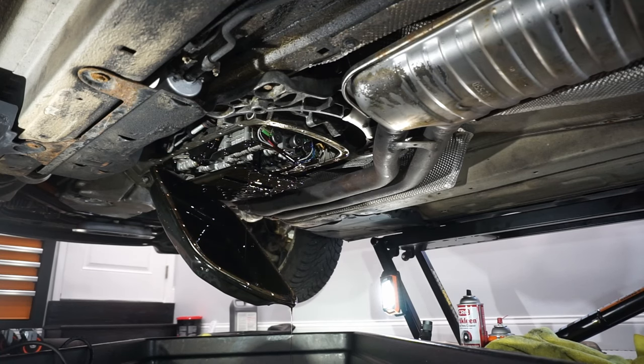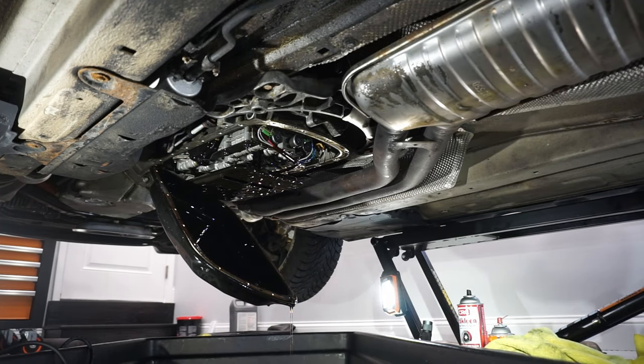First things first, because my car has been sitting for so long, everything was very cold. I took a heat gun and I just went to the perimeter of where all the bolts were and heated them up. And then I shoved in a very, very skinny, thin metal upholstery pry bar. I'll post a link in the description if you guys need it. That allowed me to just get in where there's some flat spots on the transmission, and I just gently pried. I wasn't recording because I was just trying to see if what I did worked, and it worked pretty damn good, because it literally popped off.